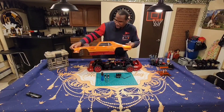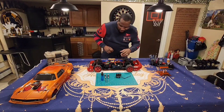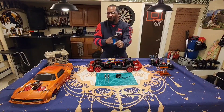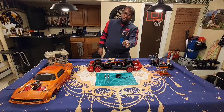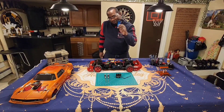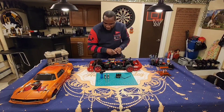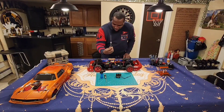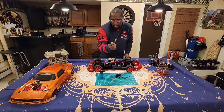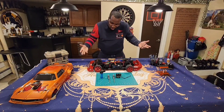Today I'm just going to show you guys how to put it on — pretty simple. Let me get the body off. First thing you're going to need is a torch lighter. If you don't have a torch lighter, please invest in one — stop stripping your screws. This is so important. Next thing you're going to need is a 2.5 millimeter and a 2.0 millimeter hex key to get your screws out.